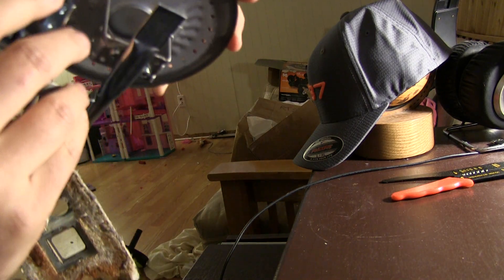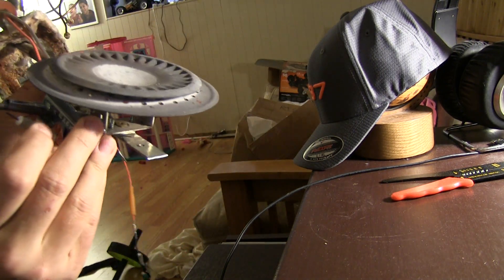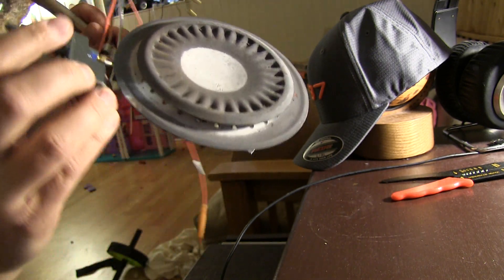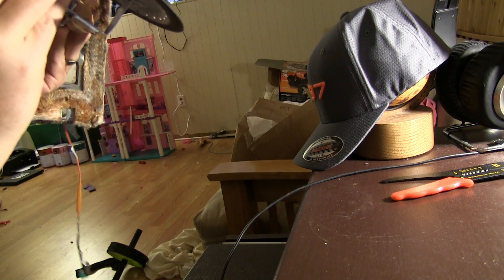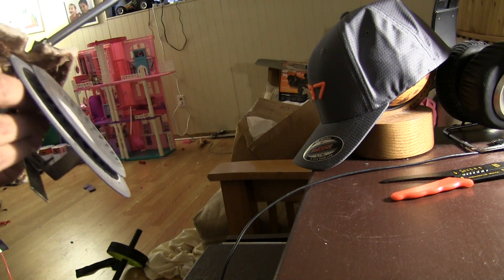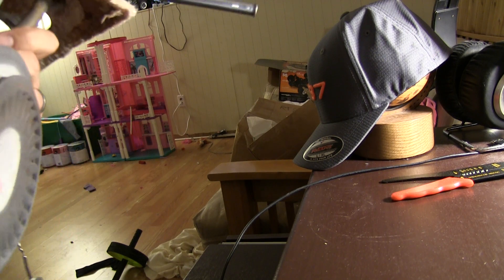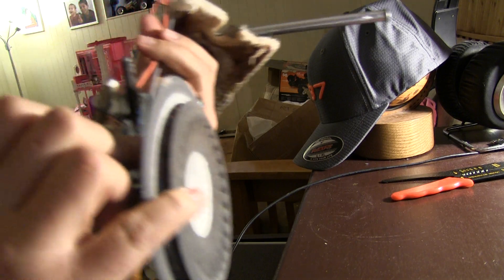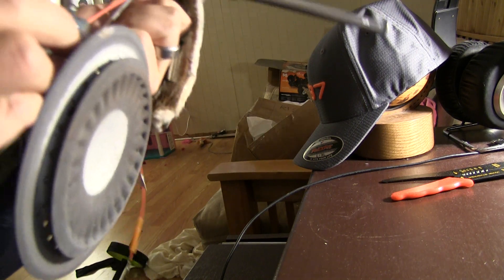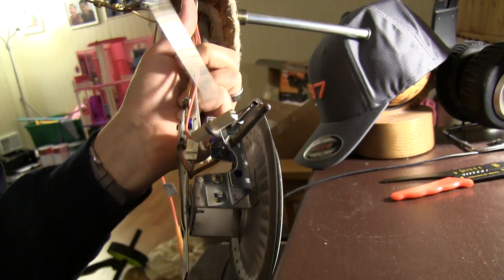This new one will just line up the same way. I was warned by the plumbing store to be mindful of that fusible link. He even alluded to the fact that my thermocouple unit might actually have been good, and it could have just been the fusible link that failed. But regardless, according to anyone I've spoken with, it can't be repaired or replaced. This unit cost me a little over $80 with tax, and I had to go to a mom-and-pop plumbing place. I could have ordered it online, but we like hot showers, so this had to be done today.